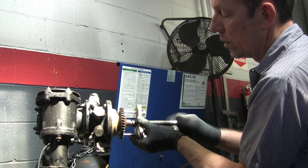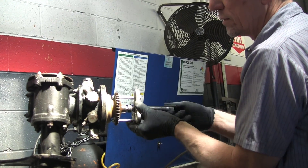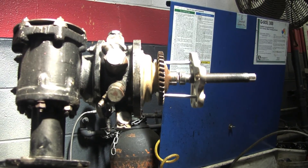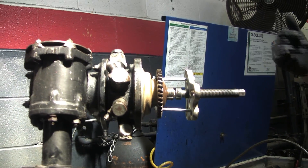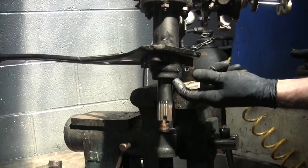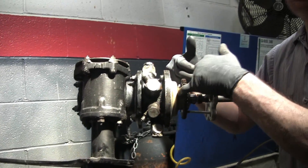Is this something that's pretty common? It's not very common usually. The biggest problem with these is they'll leak. The biggest source of leaks are the two big seals — there's a pitman shaft seal down here, and there's another seal behind here which we'll get to.